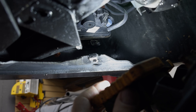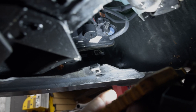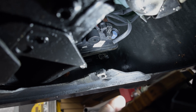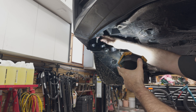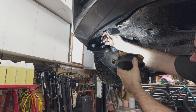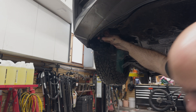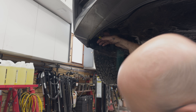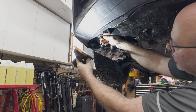I've pulled back this shield and I'm just holding it down. That black plug is what we're going to undo, and then we'll give that light — I believe it's a half turn rotation — and pull it out. It's a lot easier to deal with this lamp if you just give it a half rotation. Grab onto the harness, give it a half rotation, and it'll come out of the housing. You can see the lamp in question, and there's just a little tab right there that you have to pry up — not push in. Pry it up and you can see the harness there. Easy peasy.